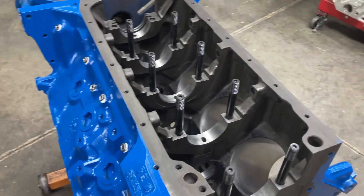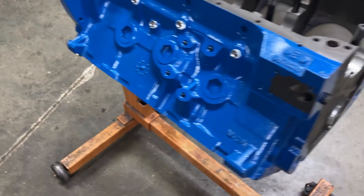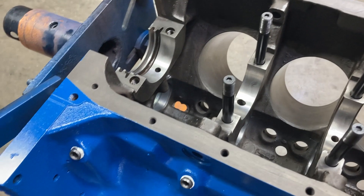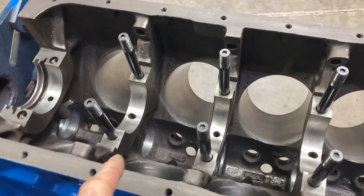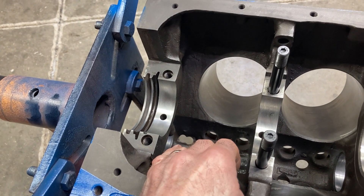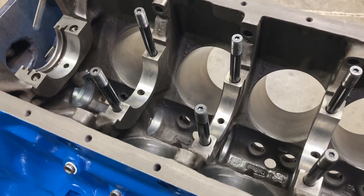We are cleaned up and painted, and this is what she looks like. Managed to do it without running the paint — I will admit I'm an engine builder, not a body man, but I did a pretty good job on this one. Got our ARP main studs already fitted. If you notice, there are no studs in the back — that's because we use bolts in the rear cap. ARP has a really nice bolt kit for FEs that includes studs in the front four mains and bolts in the rear main. If you use a stud in the rear, the nut sticks up way above the cap and you have a hard time getting your oil pan to fit. So I use this kit with the bolts in the back, line-hone it with the bolts in the back, and the pan fits really easily.